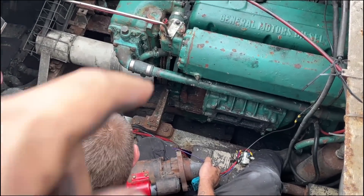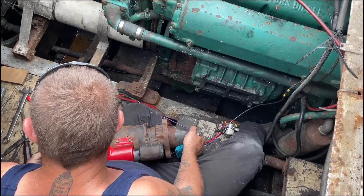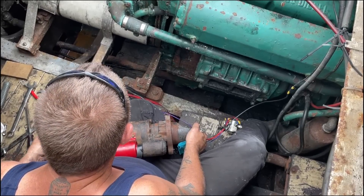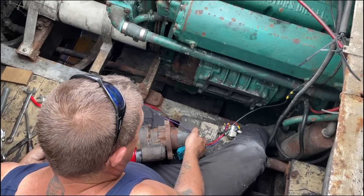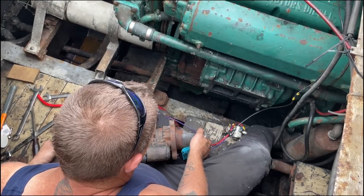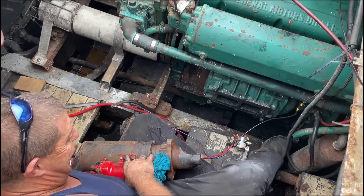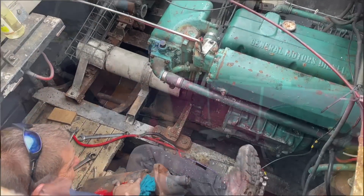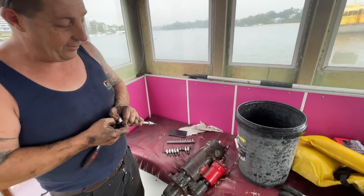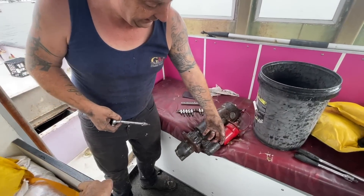Adrian's had a go — it's turning, just turning the engine over and no luck, but we're going to throw the starter in anyway. It's a bit awkward to turn. We're not convinced it's seized, but the blower's turning, so the blower's not seized. And we do believe it was running, so we're going to re-clock the starter motor — it's just hitting the blower.